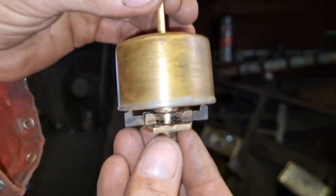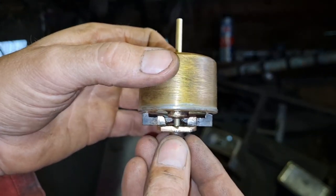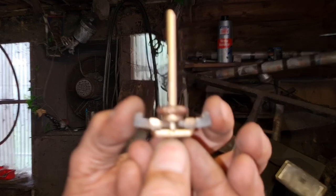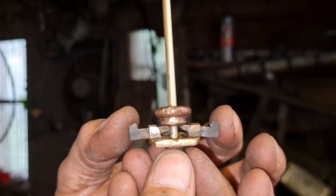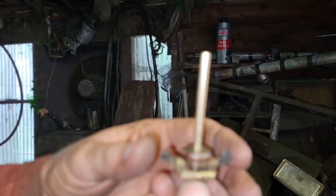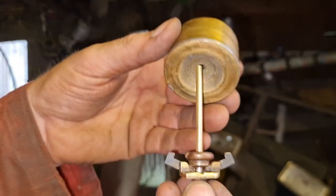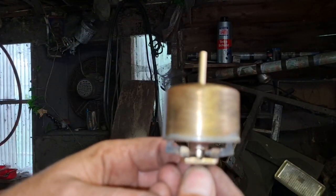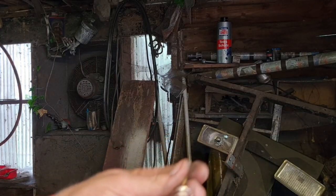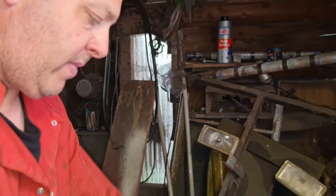You'll see how that works. Your seat screws into your carb body - if your float lifts, there you go, you can see it now. See them little arms lift up? When your float lands on it, that lifts the arms up which lifts that little rod up - lets petrol in. As your float sinks, it pushes down on that, and basically that's how it works. So as your float floats down, your fuel is on, and as you lift the float up, that sinks and goes off. It's a bit sticky because I've still got valve grind paste in there, that jet hasn't been cleaned out yet.